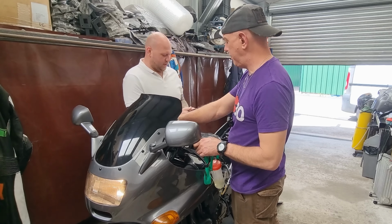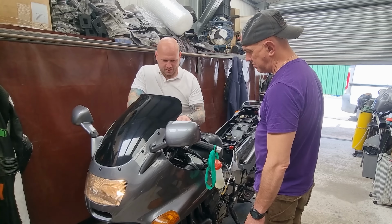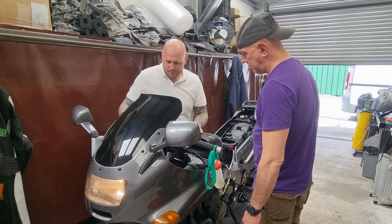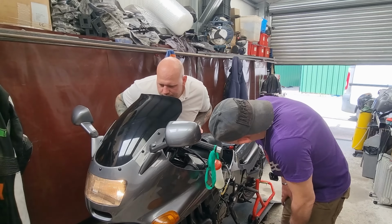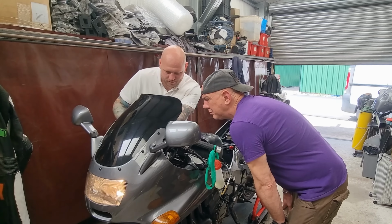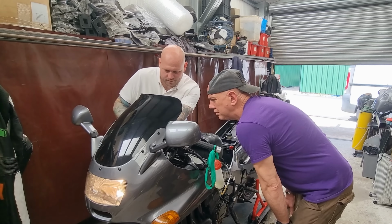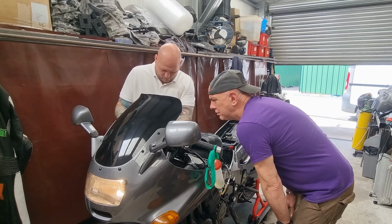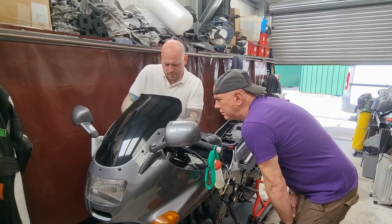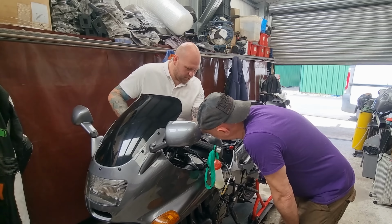That's weird. You switched them over and tightened the plugs back up, didn't you? Yeah, I've only had 2 out because that was the one that was cold. It definitely sounded like it was spitting back through the carb, didn't it? That definitely looks like the cylinder's dropping in and out. Fuel's definitely pulling through, isn't it?